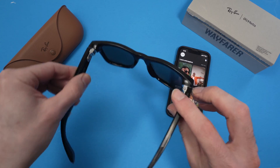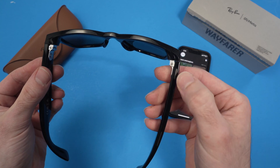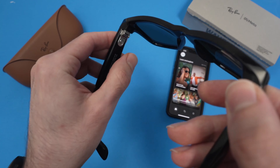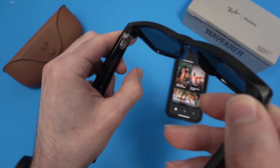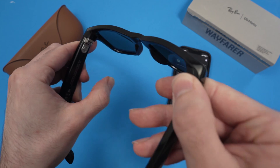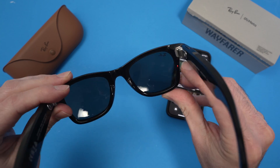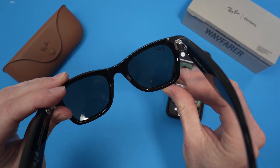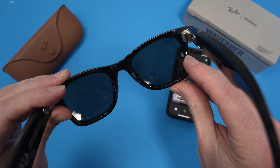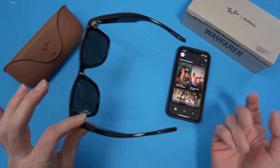You can also force a restart on your Ray-Ban Meta glasses. To restart your glasses, make sure they are turned on. Keep pressing this side button here on the right side temple. Switch them off, wait three seconds, switch them back on, wait three seconds, and then release this button. This LED over here will flash white and red, and when your glasses are ready it will flash green — just once. Okay green, you see it means that you're good to go. Hopefully this will solve your issue.